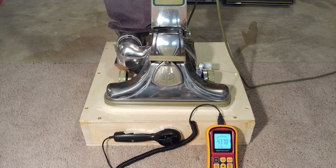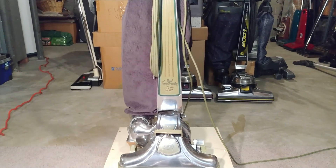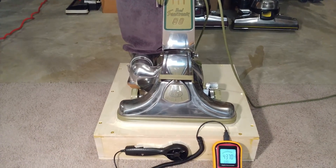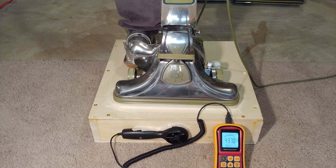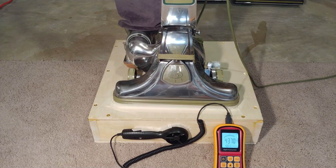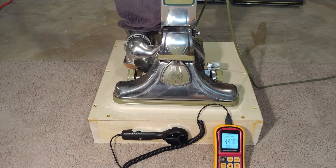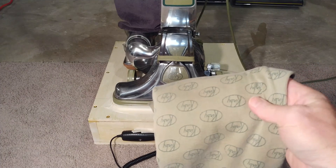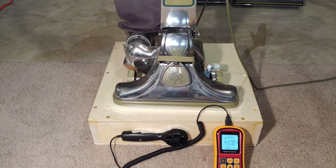So you're going to lose a little bit to start out with — rather than about 125, maybe down around 114. But remember that the HEPA bag will maintain the airflow over time as the bag fills, much better than just the original shakeout bag. You've seen measurements where as the shakeout bag fills up, it loses airflow like crazy — and this one won't.